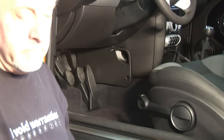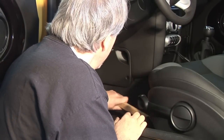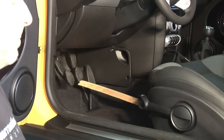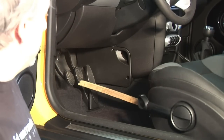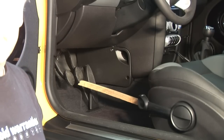All right, Brain, show me your stick. Just going to take it, notch the part in the pedal, into the seat, and that's it. So we're just holding the pedal slightly down. That gives it a little bit of pressure so we don't leak off our fluid. That should do it for us.